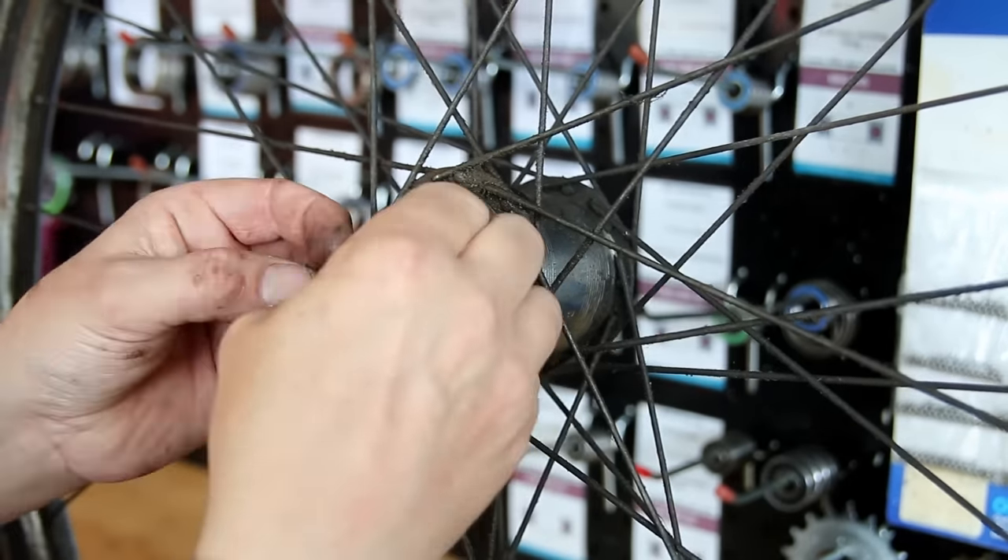They were black when they went in — now they have a lovely gunmetal finish, so we know we're really getting there. We clean off the pawls, the centre shaft for all the gearing, and all the threads using one of our detailing brushes — a nice bristled nylon brush perfect for getting into the little corners. We also clean off the hub itself using a brass-bristled brush between the spokes — what a huge difference that makes instantly.